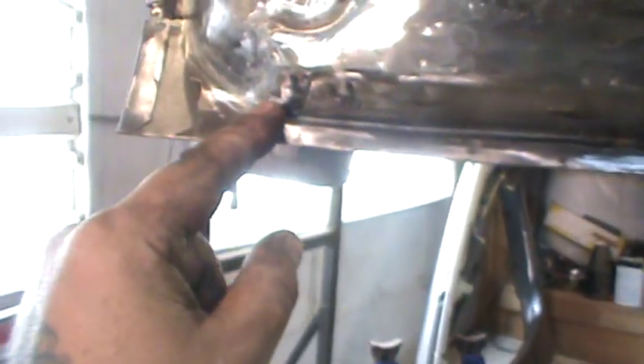My brake is 36 inches, so it stops right there — from right there all the way to here. So I had to make a separate piece for this section. Let me point this out — see how I bent that over? One, two, three — there are three layers here. The second one in between is actually the inner door skin that's been folded in for strength.